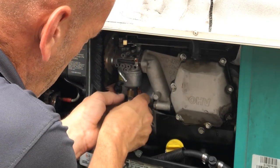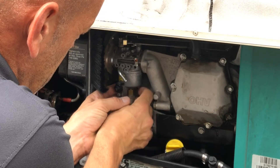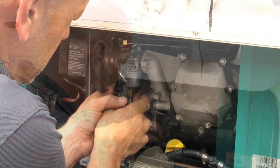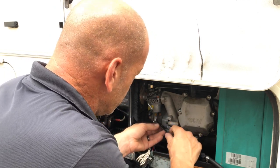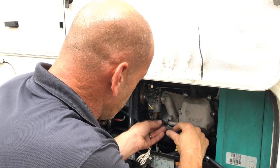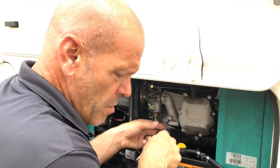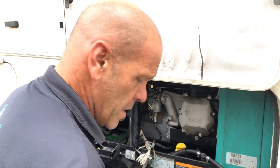Okay, and we're going to hold the float bowl up against the carburetor and screw the jet into it. Now, even though it's a crush washer, don't go too violent with this because you will break the main jet. You just need to nip it up. Okay, that's fine. Don't go too mad. If you see fuel leaking afterwards, we'll tighten it up a bit more, but we don't want to go mad with that.